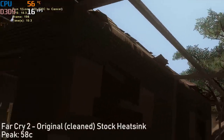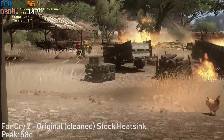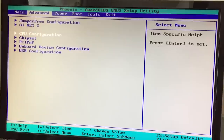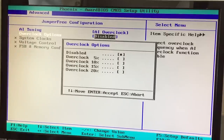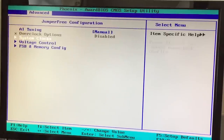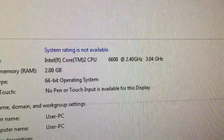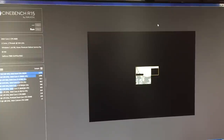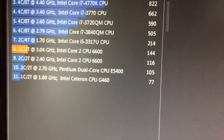With a good 10 to 15 Celsius slashed off the heat figures I'm glad I retrieved this thing from the bin. The cooler idle and lower temperatures also meant we could mess around with overclocking — something that the E6600 and ASUS board should be more than capable of. I jumped into the BIOS and played around with different settings before settling for a speed just over 3GHz. A pretty tame overclock, but one that meant we could see a slight increase in the performance of CPU intensive tasks. Of course your best bet for overclocking is to always opt for an aftermarket cooler, and with just 2GB of RAM and a 7900GS GPU in the system there wasn't much difference to be seen in games.